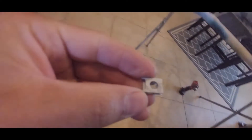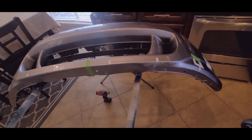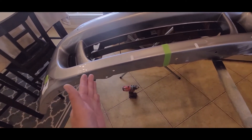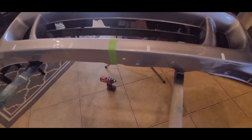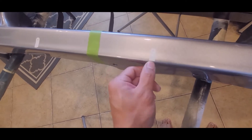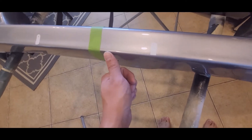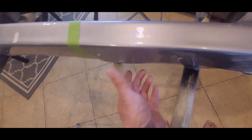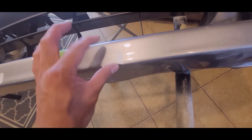These speed nuts are great for making a reference point of where to drill. The hardest part in figuring out where the holes go on this bumper is that you really have to make sure everything is aligned so it looks good. What I did was make little templates and cut them out on my vinyl cutter so I know where to line them up. Whenever you see me making a reference on height, I'm going off this line here because the bottom is different at every hole.